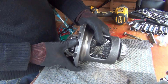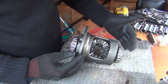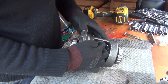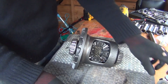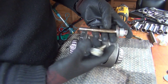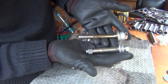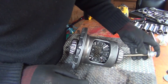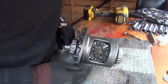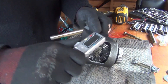Now the hard part: the clutches and spider gears are preloaded, so you need to squeeze them to be able to turn them. I'm going to use bolts for this. Those two bolts are different lengths — one is a bit longer and the other a bit shorter, because one location needs a longer bolt and the other needs a shorter one.